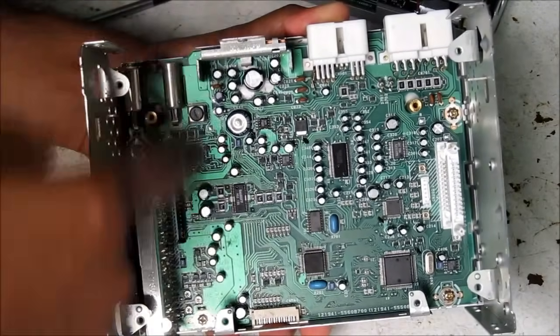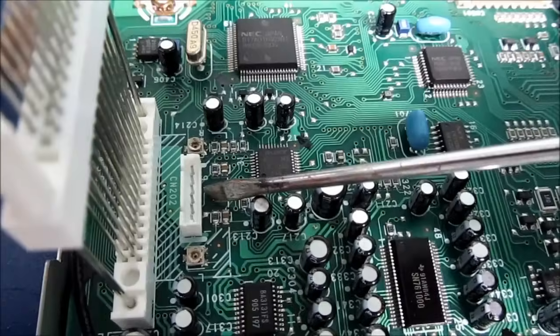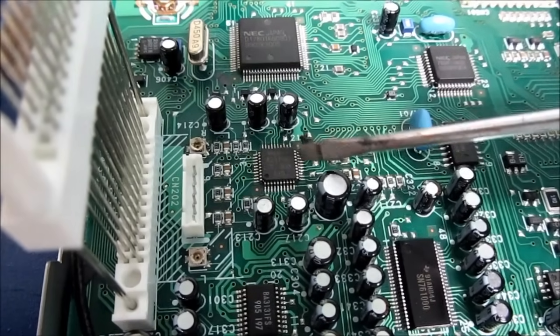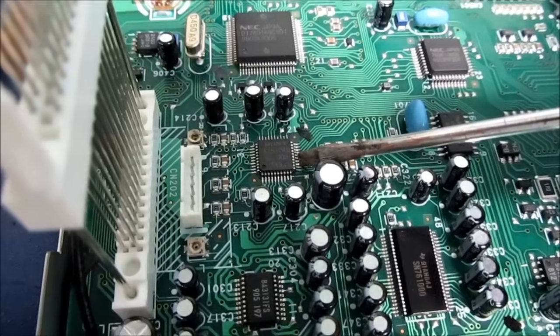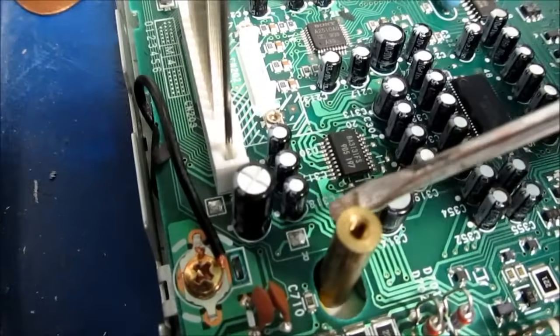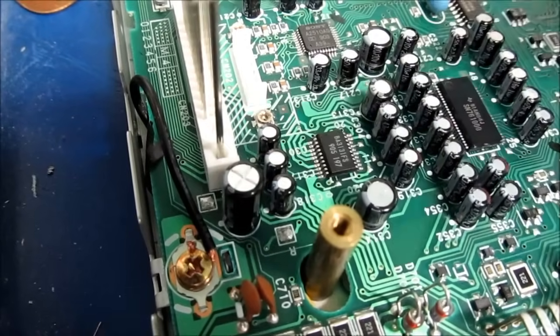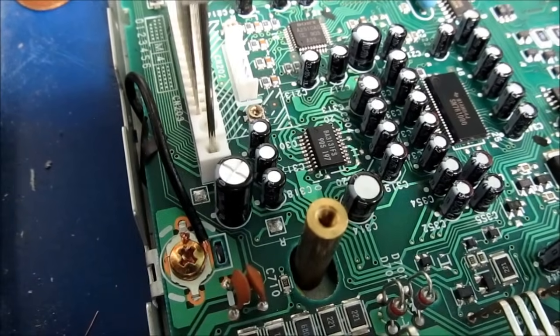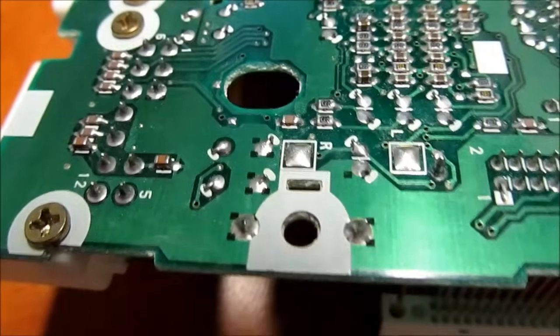There are another four screws that need to be removed to take out the motherboard. This is the output coming from the tape deck — it leads to this chip which acts as an equalizer and amplifier, amplifying the signal coming from the tape deck. That leads to these two test points right here, right and left, which I'm going to solder my aux cables to before it goes out to the amplifier. It's actually easier if you flip it over to solder to these two connections on the back.